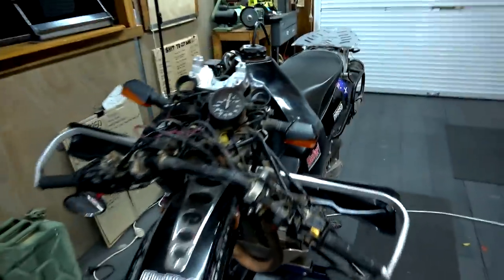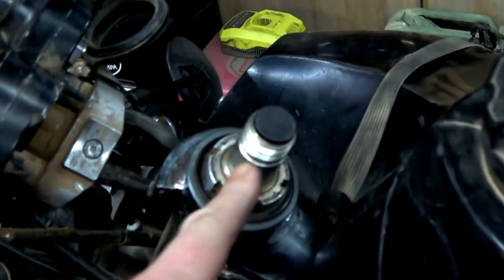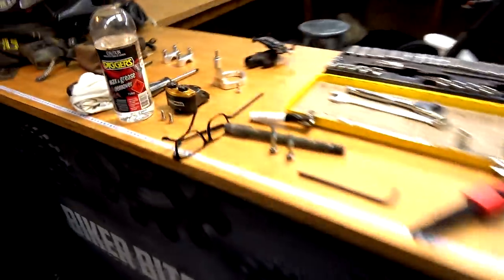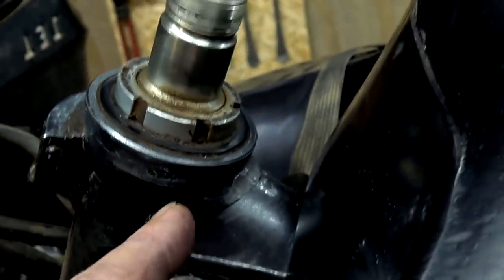I should have done the triple clamp nut — tightened that up first, then done the forks and tightened all that up. That apparently seems to be the problem. Hopefully it doesn't come off after this. What I've done is pulled him all back again. It was the nut that holds that onto there, that goes threads onto there. While I'm here, I've given this a final clean. Those welds there and at the back — I had to grind some of those welds off for the stabiliser kit to fit on there.